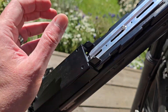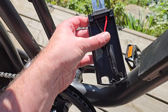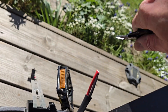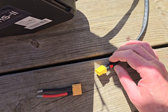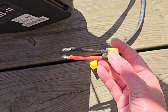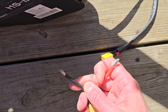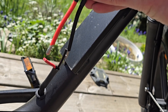Once the cover comes off you've got these two wires — red and black — that's what we're interested in. We're going to remove the old connector completely; just get some snips and cut this connector off. On the battery end we've got an XT90 connector, so we need the opposite version. You can get these on Amazon — they come with wires pre-connected. Don't connect this to the battery until the wires are properly terminated, otherwise you could end up with a problem.